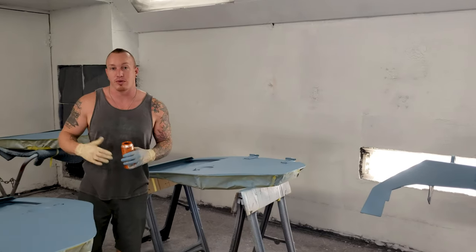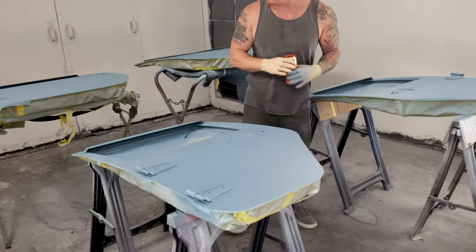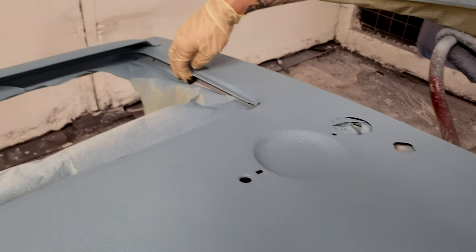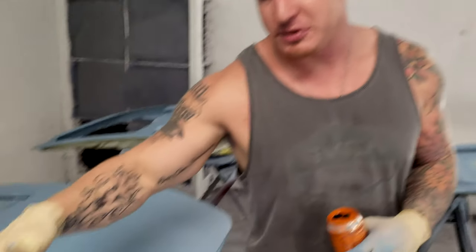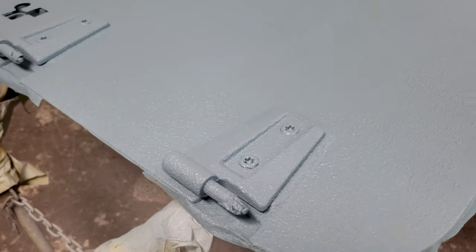And again, this is how far we went: removing door handle assemblies on the front doors, removing the door locks, which is a super, super massive process on the Jeep Wranglers. So removing all those internal components, all of the factory weather strip that goes around the window trim, the glasses outside of the doors. This thing is literally stripped down to the way Mopar would have done it, coming down the assembly line, all the way down to the door hinges being coated on the doors themselves, which is the way that Mopar does it from the factory.